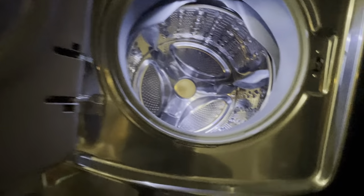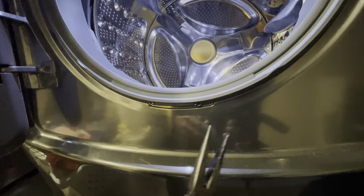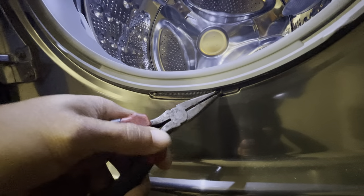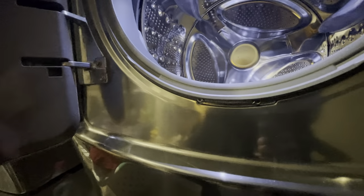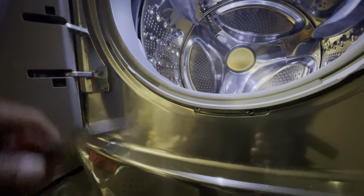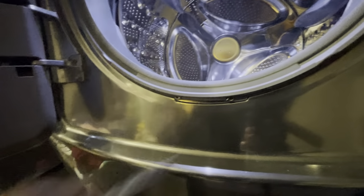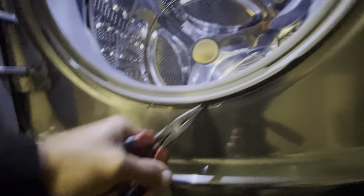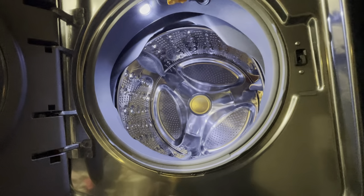Just so I have a close-up — these are needle nose pliers. Stick it in this little guy right here, this portion of the spring, and just pull it in this direction. You want to keep it dry and as much of the left side on the ring on the seal as possible, so that it doesn't just slide — there's enough friction to stretch out the spring and get the door seal on. Hopefully this helped someone out.